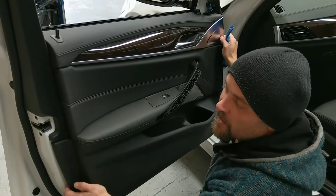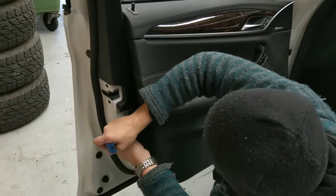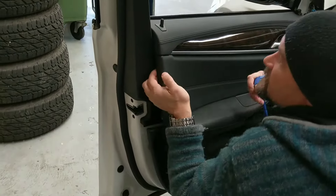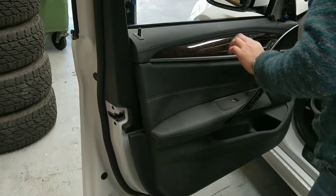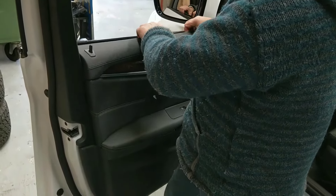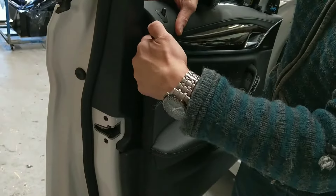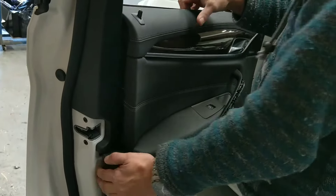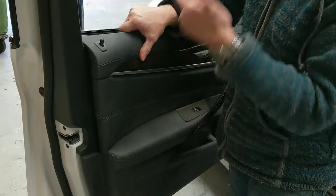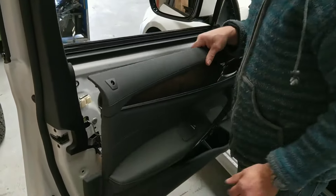In here is a different sort of plug. So you'll have a normal door trim plug to release here. And then what the trick is with this is you need to grab the top of that and unhook it. What that does is it pops the plug above it and the plug underneath it. Now the thing is with that plug there, it slides. So you lift it straight up and the door trim will come off.